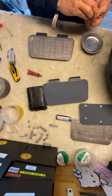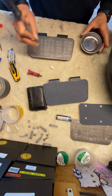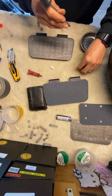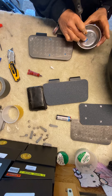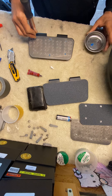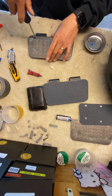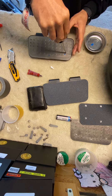If you use Loctite — the blue Loctite — make sure you don't put it anywhere on plastic because it eats plastic. I found that out the expensive way when I was working on my Goldwing. Since everything is made of plastic on the Goldwing, I came in the morning and half the stuff was hanging off of it.